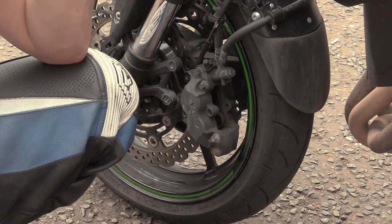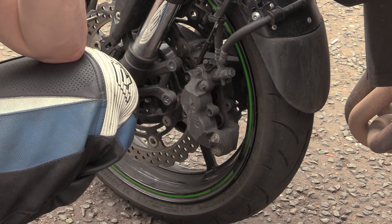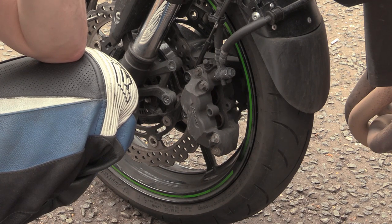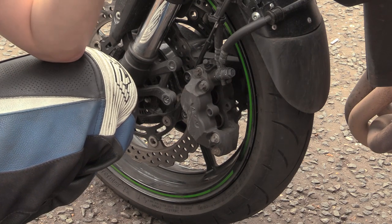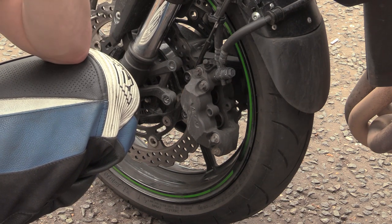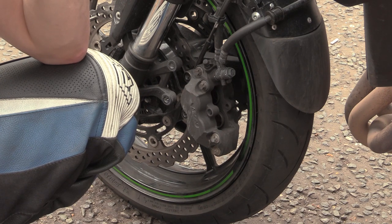Well. Right, at the current rate I'm doing, I could wear these to that limit of 18,000 miles. People always say on forums and stuff, how long should a pair of rotors last me? Well, it depends how you ride and you brake. You get what I mean? So, the nearly a year that I've done, because November would be a year, I've taken off that much, and this should last me another 18,000 miles to wear out that limit.